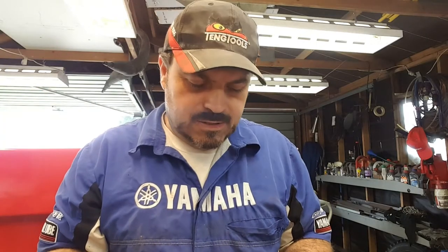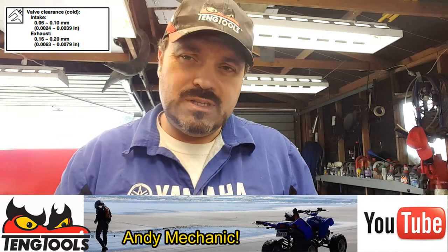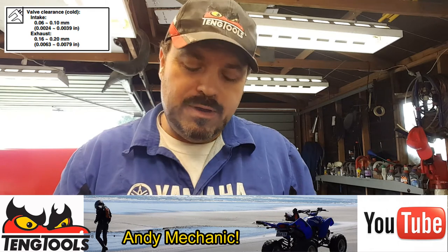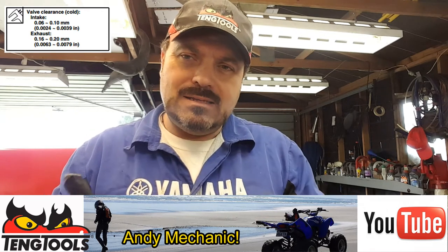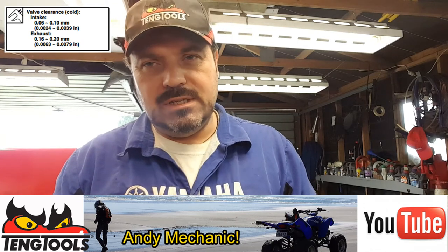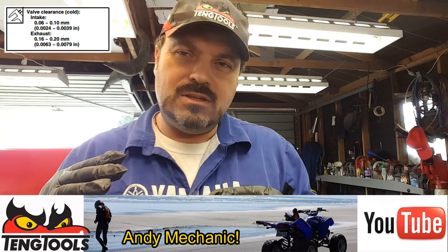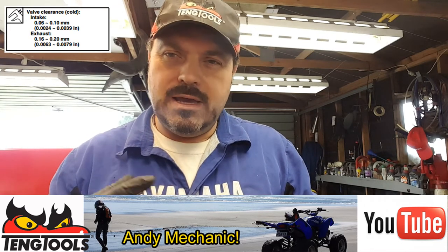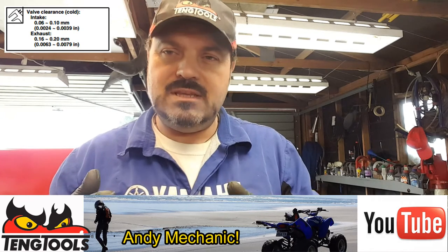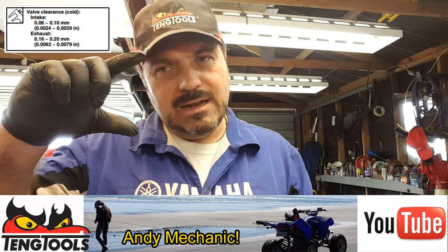Now, valve clearances. The manufacturer gives you a range. It's not a specific measurement. The range on this particular intake valve, on this particular bike, is 0.06 to 0.1 millimeters. Now, as an engine wears, the valve clearance reduces. It doesn't increase, because the seat where the valve sits on the head slowly wears away. The face of the valve wears down, the seat wears down slightly, and the valve ends up going further and further up into the head and the clearance gets less and less